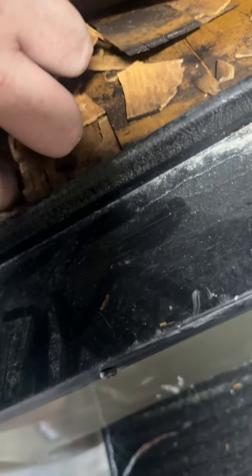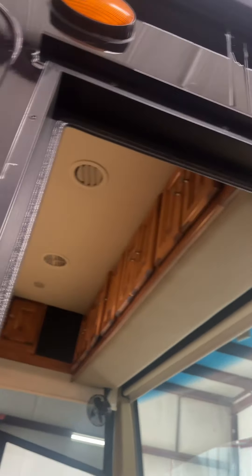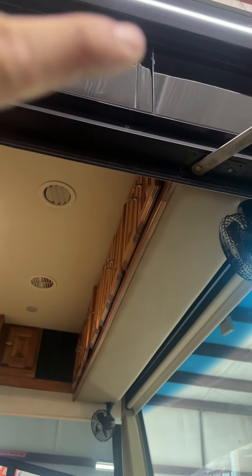This is your step tread — there's carpet over there. Below the step tread there's a screw, and you can see this has just deteriorated. Water gets in here and leaks from different places. The good thing is this is dry, so whatever was causing it they found it, but it just deteriorates that wood — it's terrible. The leak normally comes from above, around that gutter rail above the door or from the cap rail.